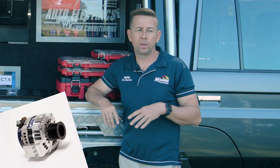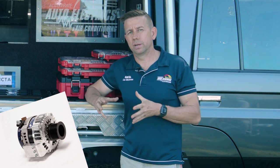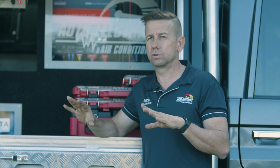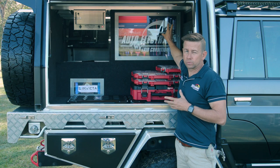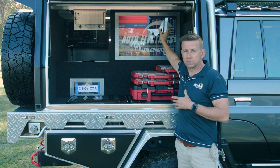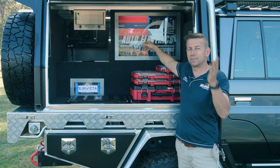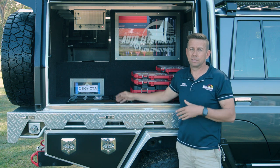To charge all of this, what we fitted is the Rapid Power 200 amp water-cooled brushless alternator. These 79s are well known for having an unreliable alternator — it's a good alternator but it's in a terrible spot. It's down low and tends to suck in all the mud and dust, and the brushes tend to stick. So the reason we've gone with the 200 amp brushless water-cooled is to make the vehicle reliable so we can go through any sort of mud or dust. The alternator is a fully sealed unit cooled by coolant, and I also get the added benefit of a full 200 amps all the time while driving to be shared across all my loads. So while we're driving without switching on the BCDCs I've got 30 amps ticking away in the canopy, and if we want we can turn on the two DCDCs for another 100 on top — charging at 130 amps, giving me that under two-hour charge rate.